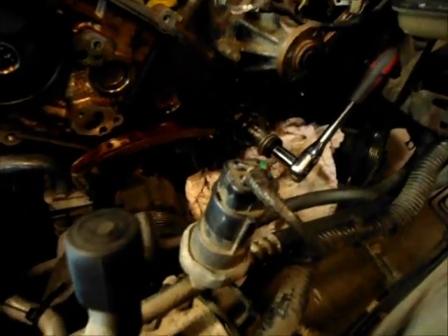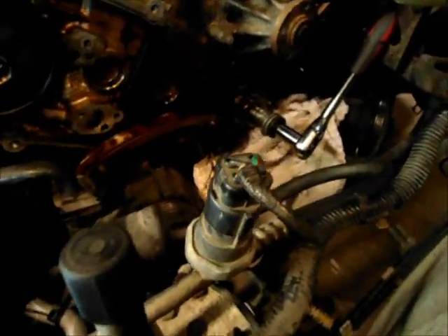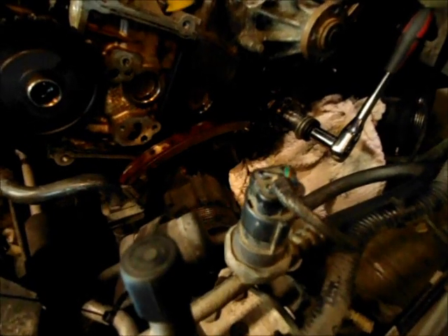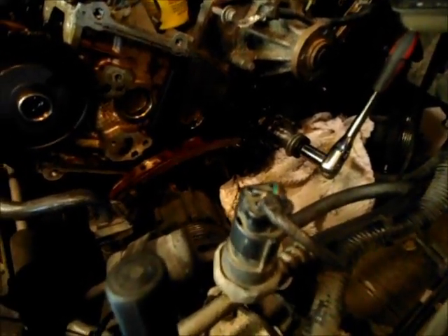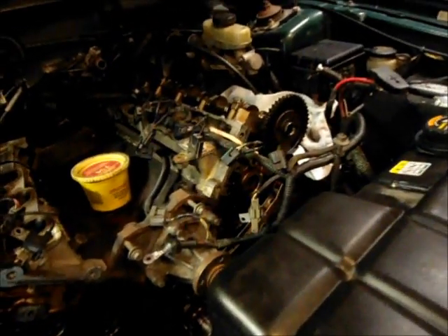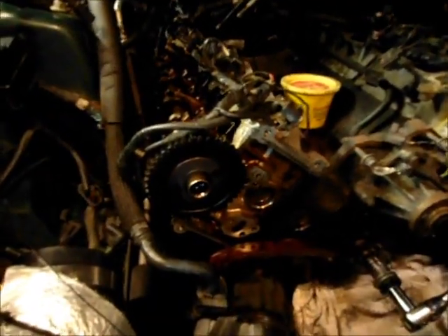The way I'm going to use this time is going to be more accurate — link mark to timing mark — but that's going to be another episode that I wanted to show you. I've taken off both of my chains. I've taken off both of the tensioners. The camshafts — I had the left one out, but I put it back in. I'll tell you why in a second.